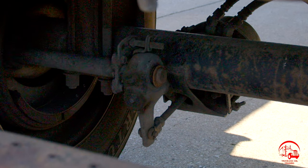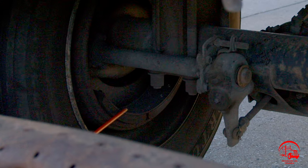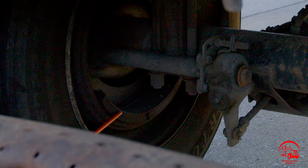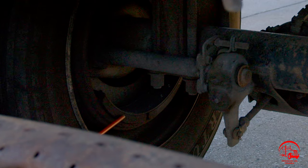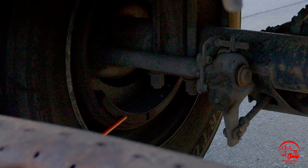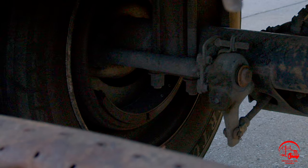released. And looking in between our tire here, we have our brake pads. They are properly mounted and secure, not bent, broken, or cracked. All nuts and bolts are present and tight. There's no illegal welds, no grease, oil, or debris, and there's no less than 1/4 of material thickness.